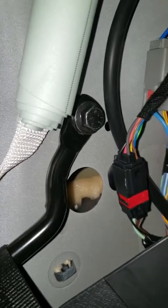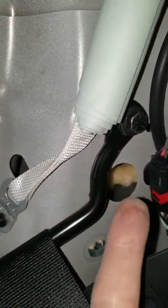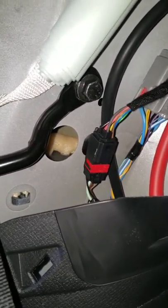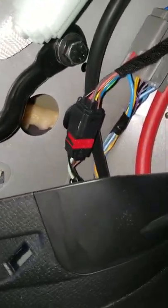And then through this hole, you gotta get a long extension — there's a bolt inside there. It's hard to see; you have to go at an angle like this, through this hole, just to get those at an angle. It's hard to get to. You're gonna have to use a magnetic socket so whenever you get it out, it doesn't fall down.